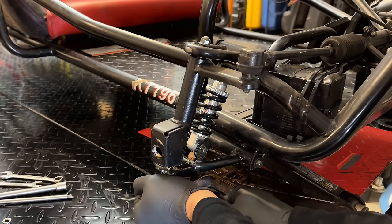So I made a trip to the local hardware store this morning, and surprisingly, they were able to find an M12 1.25 extra fine thread castle nut. So it threads on there without issue. That said, though, there is an issue. If you look at the old one, you can see those slots go down a lot further than the new one. And because of that, I can't actually put the pin where it needs to go. So I'm going to take the angle grinder and just bring this down a little bit further, and then I think we'll be in good shape.